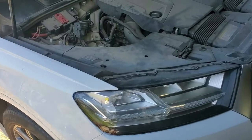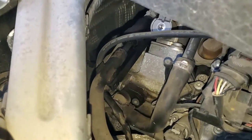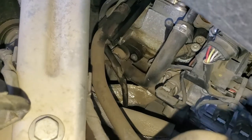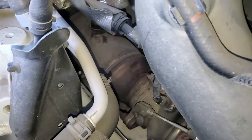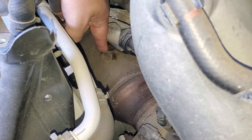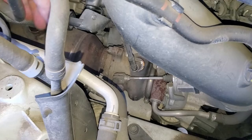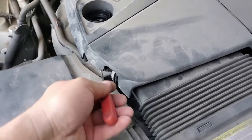Welcome to Eddie's Customs and Restorations. If you have an Audi Q7 and you're smelling gas, there is a high chance you have this exact same leak, which is very dangerous. It's in a very dangerous location — you can see down there where it leaks down to, it is basically on top of your exhaust. That's essentially the hottest part of your engine, and you can also see the residue the gas would leave when it would burn off. Due to the severity of this safety hazard, there is a service recall posted by Audi where they will fix this issue at no cost.